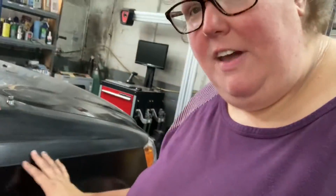So while Chris is working on the Chevy, our van is still not done. We got the bumper and the fender on. Even though we got the fender from Chrysler and it was still primed, there were still some imperfections — just little chunks of paint. So Chris had me lightly sand it and now I'm going to go ahead and just scuff the rest of this down to take away the shine so we can get it properly prepped for a flawless paint job.